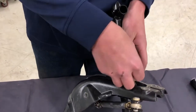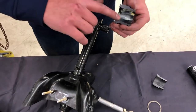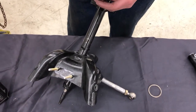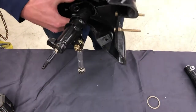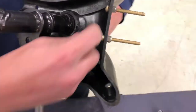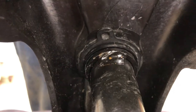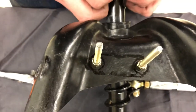The clip is removed and the bushing comes out from the top. Brie is going to put some grease into the anti-slop steering post bushing on the inside — that's just white lithium grease, though any grease would work, high temp or low temp. With a little force, the bottom clip goes back into place, and then you put the clip on the top side.